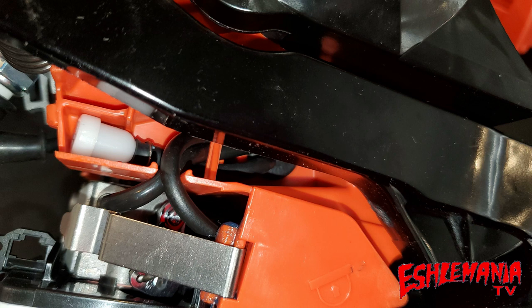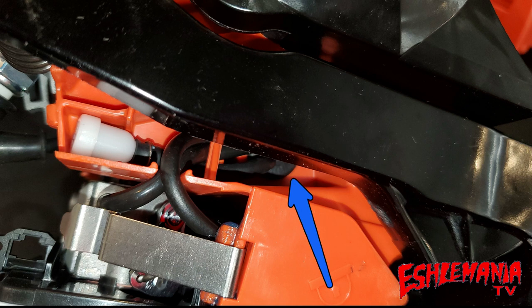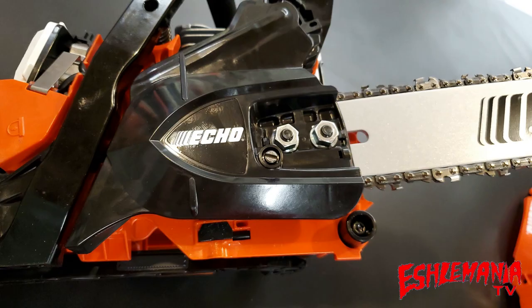Here's a part that all you DIY guys are going to love. If you've ever tried to change the fuel lines on a chainsaw, you know that can be a real pain — especially trying to fish that fuel line down through a hole in the plastic tank and not being sure if it'll seal. Where the fuel lines go from the carburetor down behind the handle, there is a grommet. Just like on Echo string trimmers, leaf blowers, and hedge trimmers, you simply pop that grommet out, replace the entire assembly, it's sealed up, and off you go.